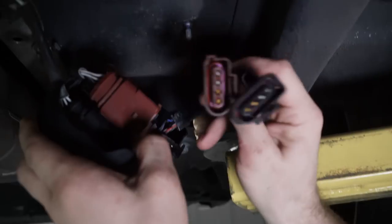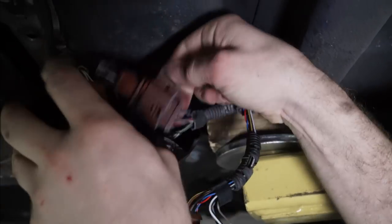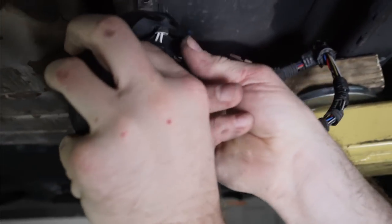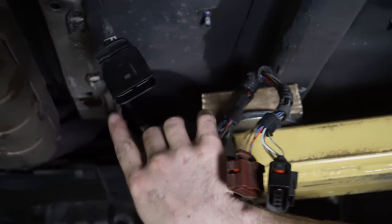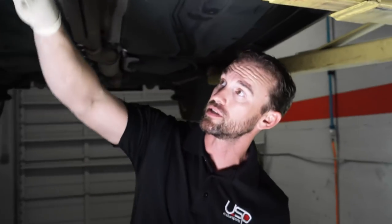The rear O2 sensors are going to be the four-pin connectors. That's really showing its age there, Charles. Yeah, it's starting to show its age. So here are our two rear oxygen sensor connectors — we can actually leave these just where they're at. Just an FYI, in the beginning of the video I cheated a little bit — we did use some PB Blaster. As you can see, we've got some rusted bolts. I would definitely recommend leaving this soaked for about a half an hour or so and then starting the job.